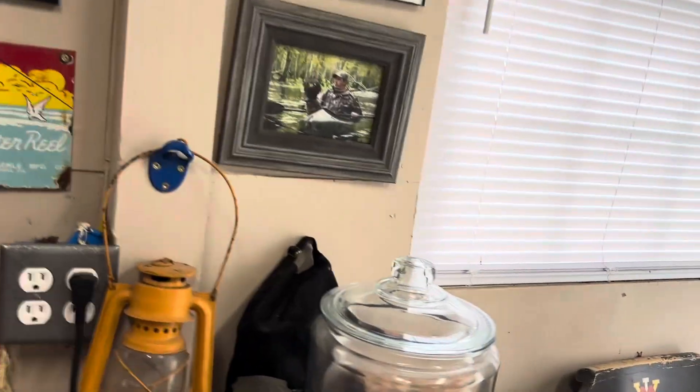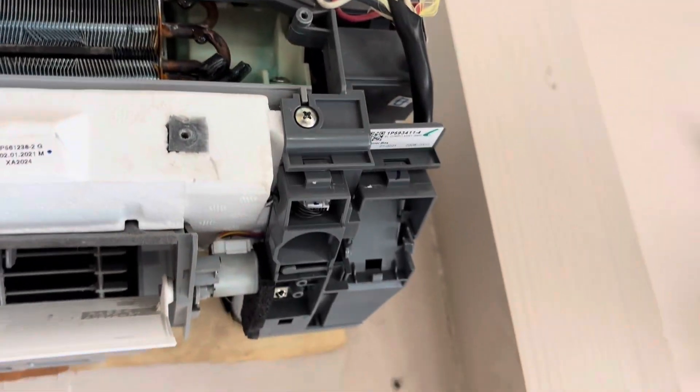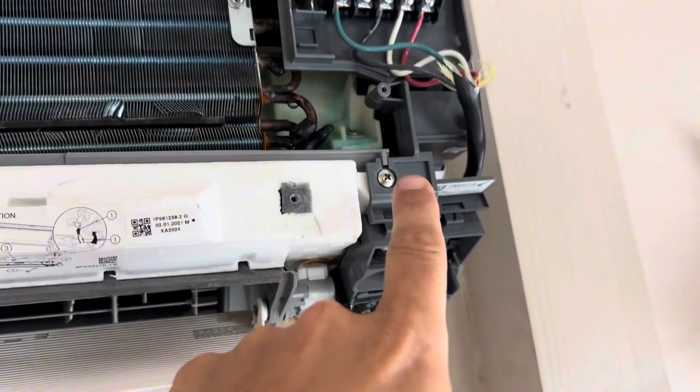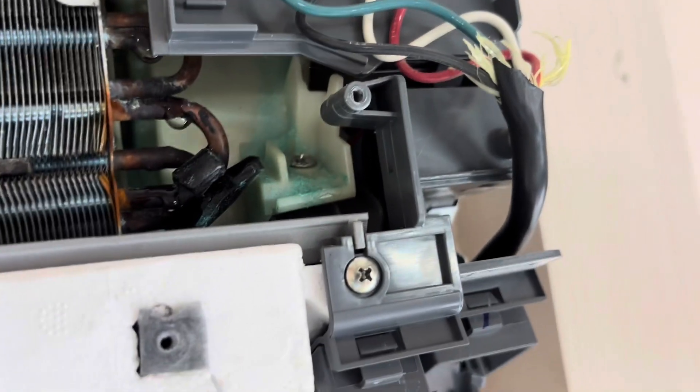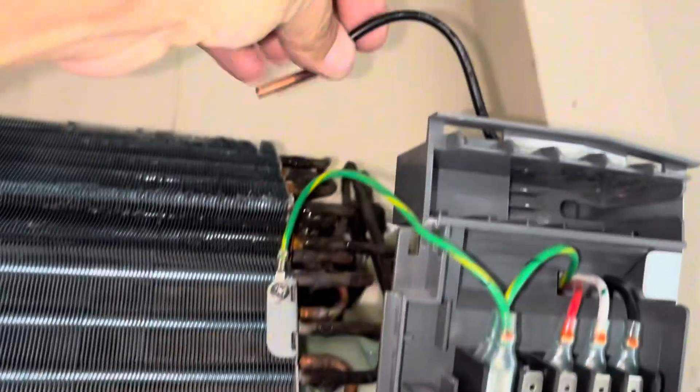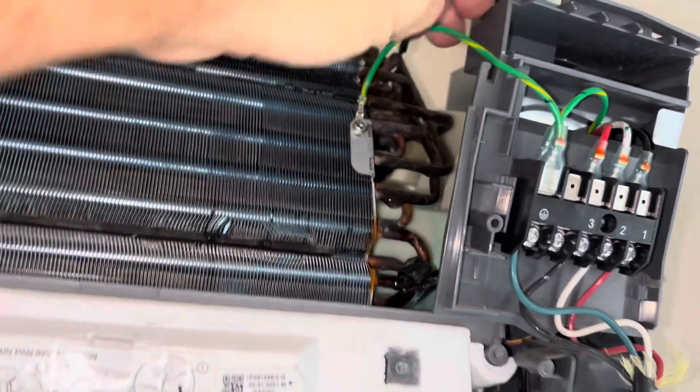We are replacing the blower wheel on this because there is a huge chunk missing out of it. We're going to take this screw off too, and that will loosen our blower, our electrical panel, and that will be able to move out of the way. Then we have two screws there, so we're going to take out those two screws and that screw. Now I have all those taken out, and you can see this is loose now. I also loosened this sensor up here and pulled that out of there just to get it out of the way.